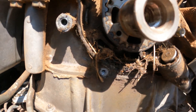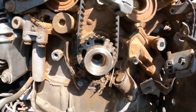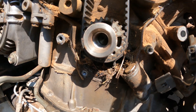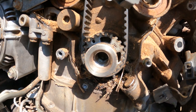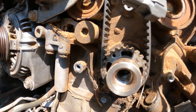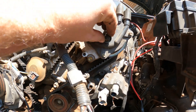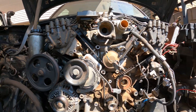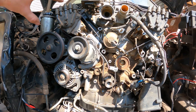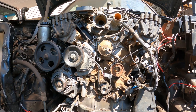So I'm not 100% sure how the pickup works, but for you guys that are clever and know this stuff — do you think that this could actually influence the reason why this engine won't rev up? Because I've got an idea, to be honest. Next I'm going to clean all this. I also want to take off these covers to check my timing. I did set it to top dead center before I removed the pulley, so let's quickly take off those covers and double check the timing — that this belt maybe didn't skip a tooth or something like that.